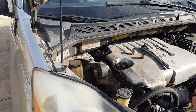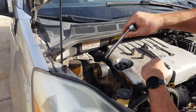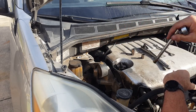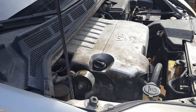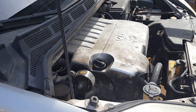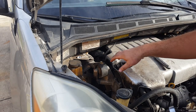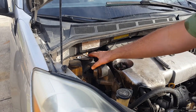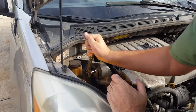This is an easy one to get to and it's only 40 bucks. You can see just by putting it into park and shifting to drive, it plays around in here because the bushing is broken inside. So I just need to make a quick change here - two 14mm bolts right here and the 10mm to get the ground wire out of the way.